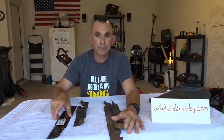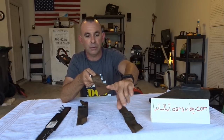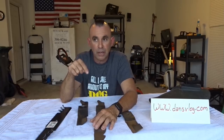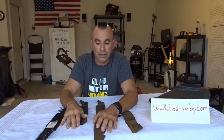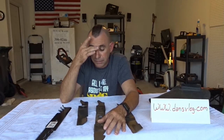That's blades in a nutshell for the beginner. If you're mowing and having trouble mulching, invest in a set of gator blades. If you're bagging and it's not vacuuming well, look for high lift blades — or check if your existing blade is so worn that the lift is gone. Sand and dirt wear the lift down over time. Leave your comments below, check the links down below. Next video we're going to put all this knowledge to work — we're going to side discharge a yard that's in pretty rough shape. Appreciate you guys.